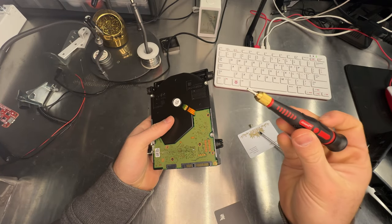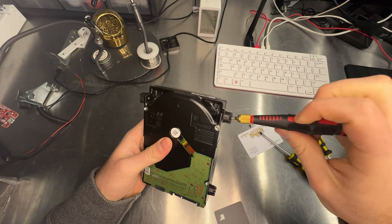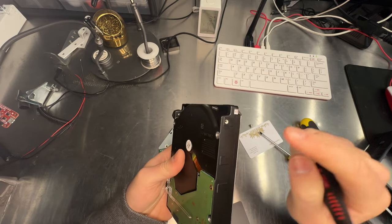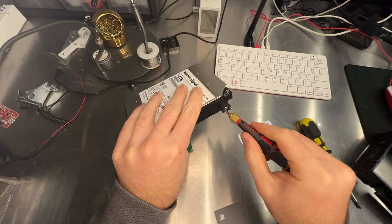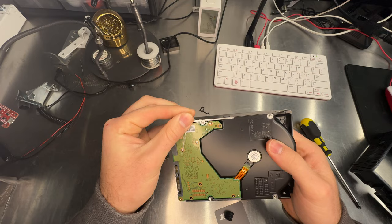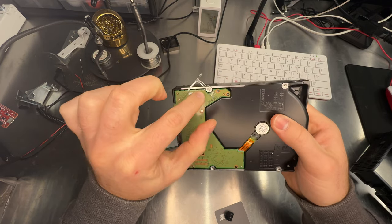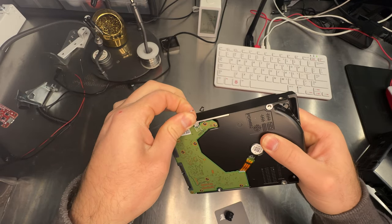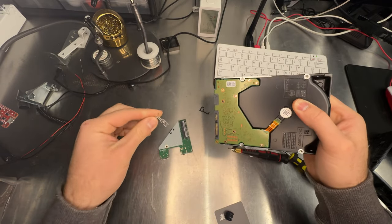For the remainder of this hard drive, I have a Torx T9 bit and I'm just going to unscrew these little rubber feet from the side so that I can mount this in my hard drive trays in my server. The last thing we'll do is remove this little plastic indicator light — it's got a little adapter into this hole. We'll just pull it out and save that.